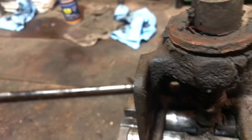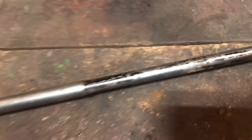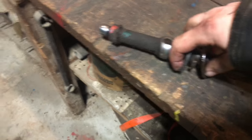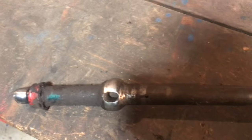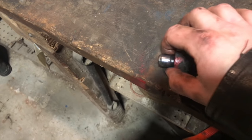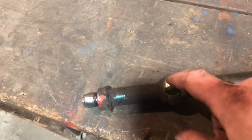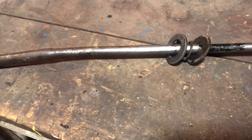This is the worn-out bit down there. I haven't taken the ball apart yet to see how that is. I noticed something else on this stick when I went to take it out - this spring is supposed to be squished between these washers, and then there's a roll pin that goes in right here to keep pressure on the ball. That spring's broken, and this ball is a little bit sloppy. This is actually the little ball that pulls on the rod that goes to the shift forks - it's the ball that takes all the weight of everything. I'd kind of like to get these sticks plated while I have them out of the truck so they look nice.